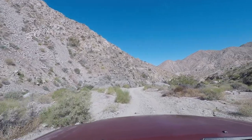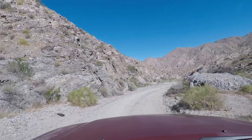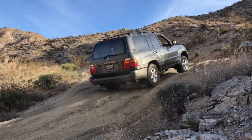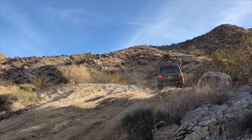Unless you're going through really muddy stuff — which we don't have a lot of on the west coast, it's mostly dry sand and desert — the open differentials are generally okay. Sand, mud, snow, or ice is where that's going to be a problem. On dry trails with moderate inclines and not a lot of articulation, you'll be fine. The pro for the Sequoia is its cargo space: the rear seats fold out, there's a third row, and I've got a mattress back there where I can lie down and take a nap.